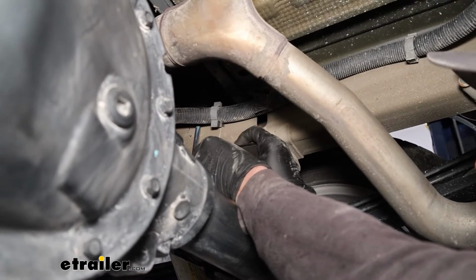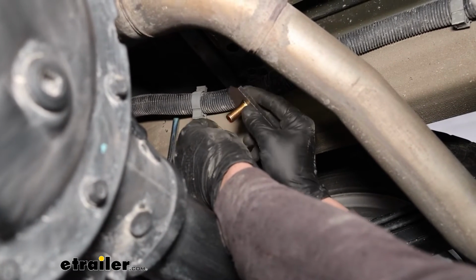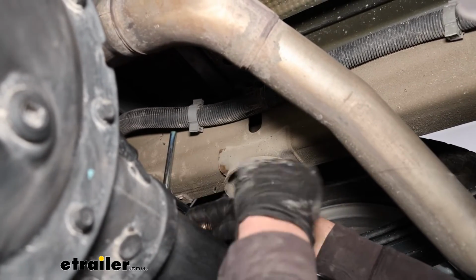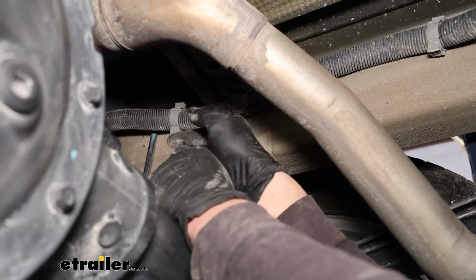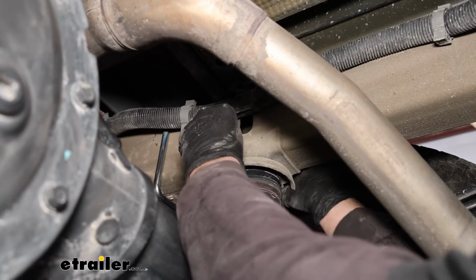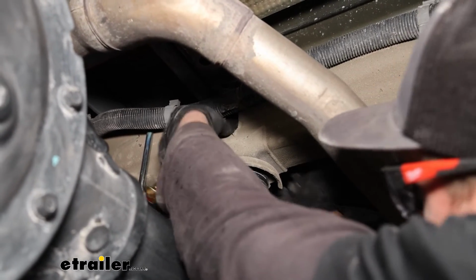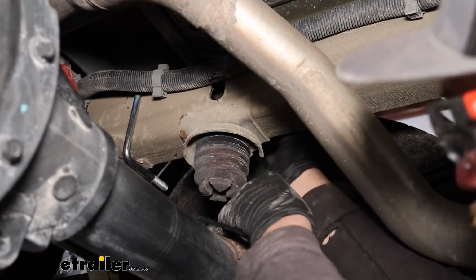You can now grab one of our fish wires, a carriage bolt, and the spacer block here. You'll set it up like this, and you can take the bolt that's going to thread onto the fish wire. This oval shaped hole here in the frame right above our jounce bumper goes straight through to the outside of our truck. We're going to take this straight end here, push it right through to where we can grab it on the other side, and then we'll feed this hardware into the frame just like that until we pull it and it comes out the other side of the frame.